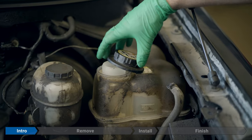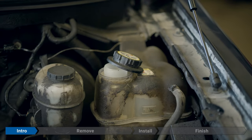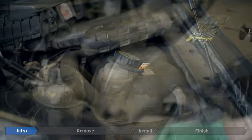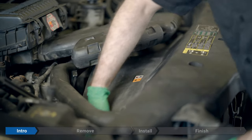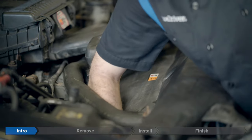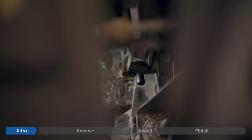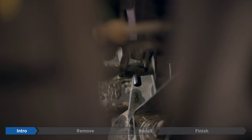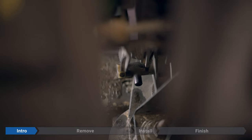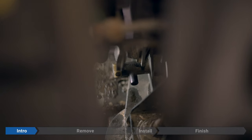Just move that aside and leave it a little loose, so the air can equalize while we're draining the system. On the passenger side of the truck, down on the bottom corner of the radiator, you can see the petcock. We're going to open that up to drain the coolant. We're going to take a length of 3/8 inch hose, press it over that, and run it down by the frame to a bucket or drain pan under the truck.